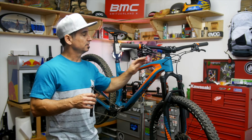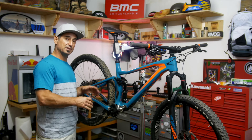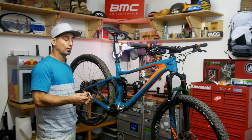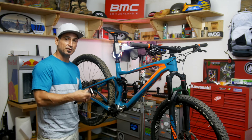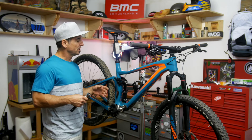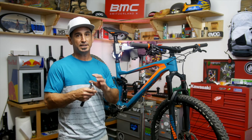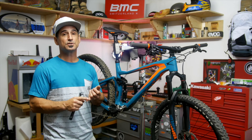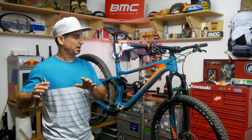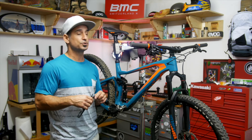We've shown you all the tools you'll need. If you've gone through all the nuts and bolts on your bike and you're noticing pieces and parts that are looser than normal, or you're re-tightening them every week or two, it's a good idea — especially with shock bolts or derailleurs — to remove them completely, clean them of all grease or foreign objects, reinstall with clean new Loctite, and put it back together under proper torque. You should be good to go.